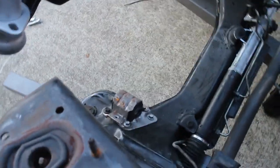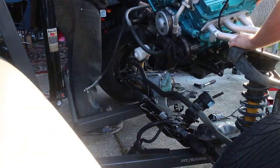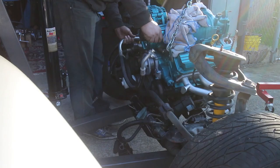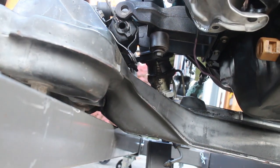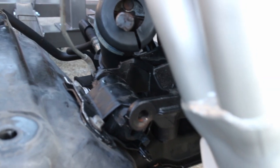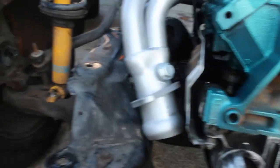Get the bolts out of the engine mount. We basically just need to line them up with the engine mount on the subframe and get a bolt through. As you can see, mine is pretty much lined up. We're just going to adjust it and get this bolt through so we can get the nut on. They're just definitely not lined up correctly. The chain's not holding up much, so I think we're pretty much good to start adjusting it.